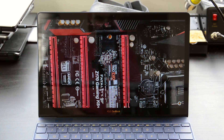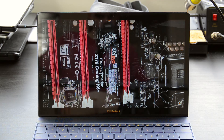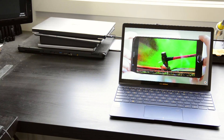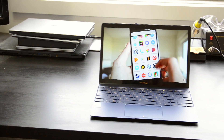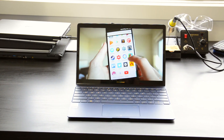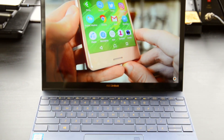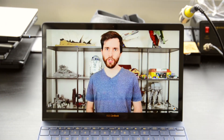That said, I quite like the display — it's a 1080p 12.5-inch IPS LCD. It is very vibrant and can go up to around 340 nits of brightness, which I think is perfectly fine. There is some awkward dynamic contrast going on that you cannot disable, which makes it not the best option for creative professionals who demand sRGB color accuracy. But for most everyday users, you'll be very pleased with the vibrant and saturated results that the ZenBook 3's display provides.